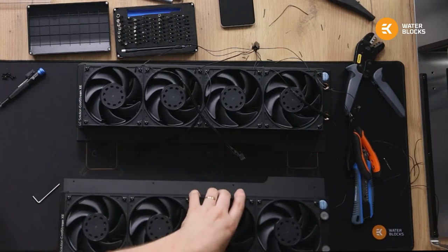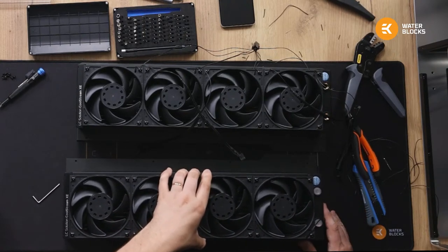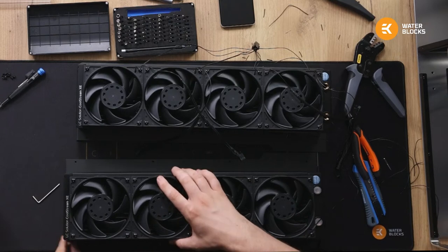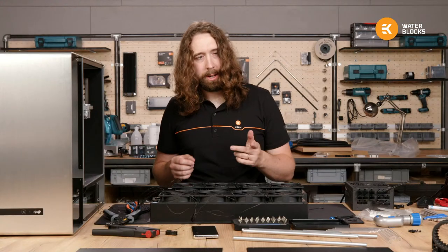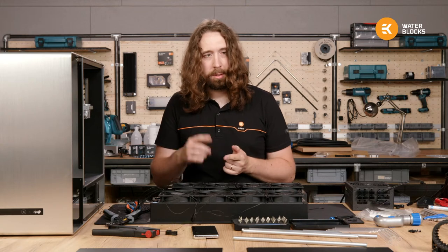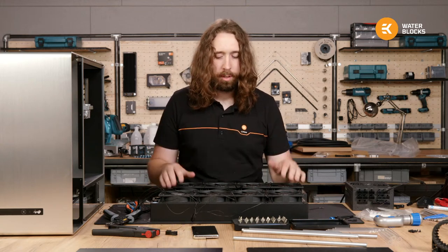Generally, high speed fans do better with 5 volts. If you get a really low range fan that only goes to 1200 or something, then they very rarely turn on with just 5 volts. But you can always make 7 volts by using the 5 as a ground and plus 12 as the power. So then you have 7.